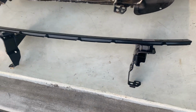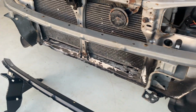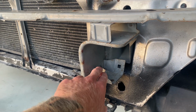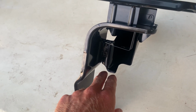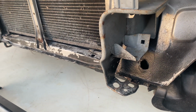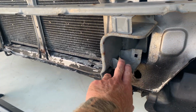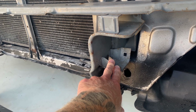So as you can see, I've got a brand new Subaru genuine bumper iron. Although obviously this car has one, and it's actually in pretty good shape really, it's got a couple of variations. This factory one has these little brackets here, which the STI one doesn't. Although yes, it's just spot welded and I could just take it off, I decided this is a cleaner way to go, given I'm going to have to go through compliance on this car. And that essentially stops the STI spotlight provisions, if you like, in the bumper from actually mounting nicely.